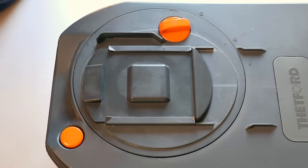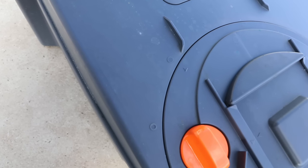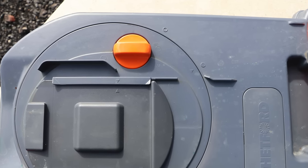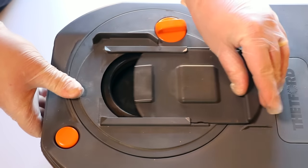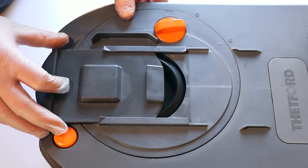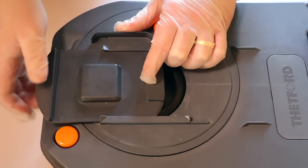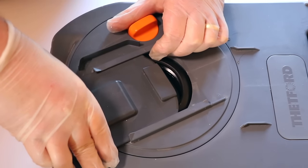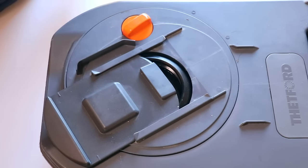Okay so let's open the cassette and get access to the seal. You will see that the cassette has a few markings on the lid: an arrow, a circle and a disc. The circle shows us that the cassette is open, the disc indicates that the cassette is closed, and the arrow is just a marker to show the current position. To open the cassette we will use the sliding cover as a handle. Simply remove the cover and reinsert it back into the grooves but from the other side. Only insert it about halfway — this gives us a lever to unlock the tank mechanism. I find it's better to push the sliding cover away from me and push it in an anti-clockwise direction, until the arrow points to the circle or the unlocked symbol.